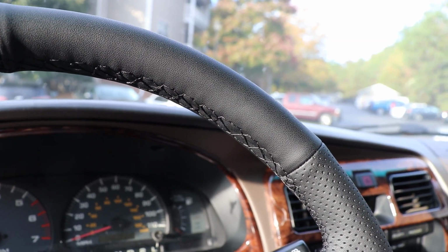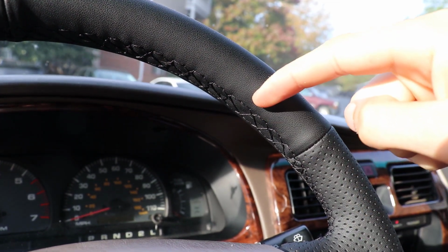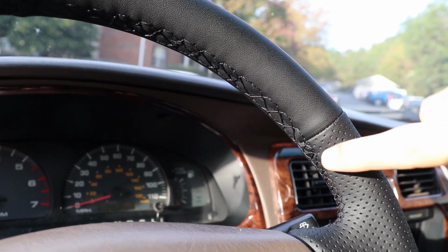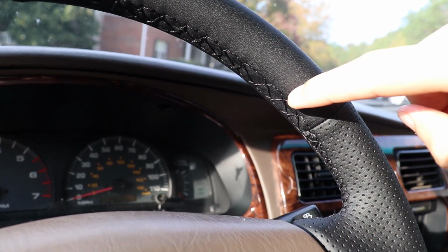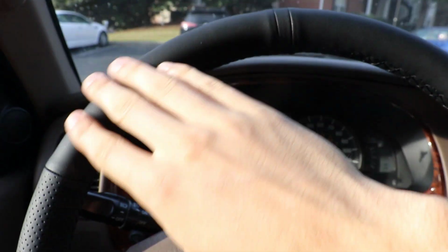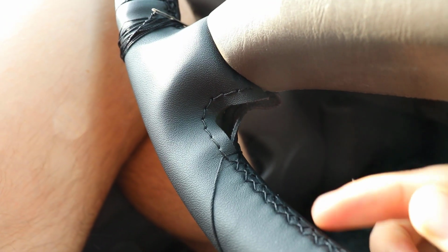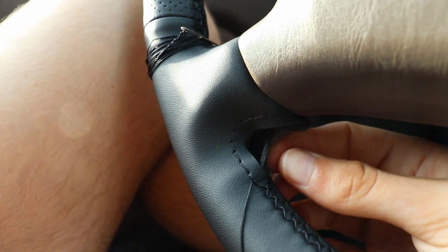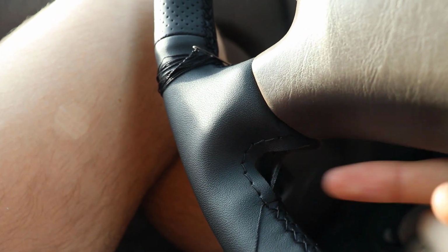Also another note, on the bottom side, all I've done is just stitching back and forth, but you can see up here, this is the skipping a stitch pattern right here. So it's going to save you a little bit of thread, a little bit of time. You can see on the perforated part, like I said, I just went back and forth, but here I skipped a stitch, and then continue that all the way through just this black upper, and then swap back to stitching back and forth on this end. And now as we approach the corner, I want to make sure that all the material is tucked in as best as possible, and then I can kind of pull these two pieces together as I now begin the corner.